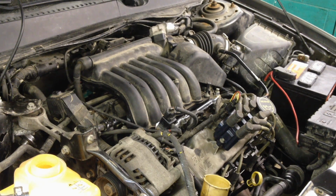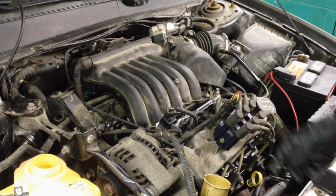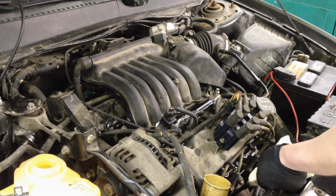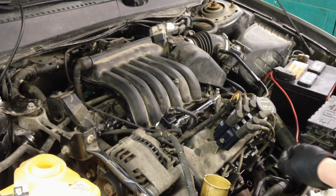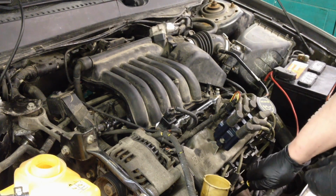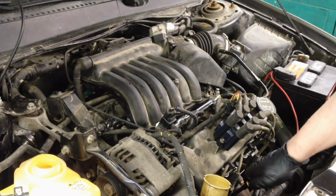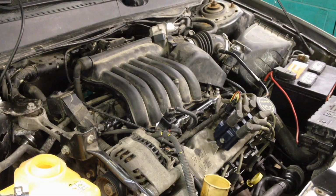And then since we did pressurize the system and fill the oil filter, we can also check the oil level before we ever actually start it. And it should be a fairly accurate reading. Safe for startup. We're at the top. We're good. Put the cap back on this.